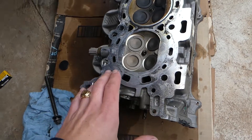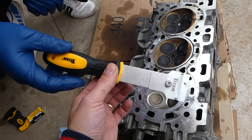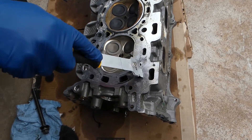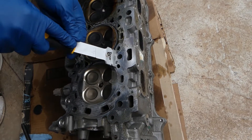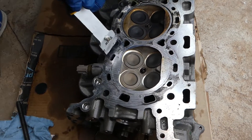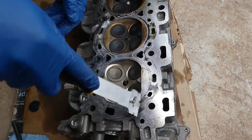You can see the head will be really bad, so what you need to do is get a razor blade. All the tools and parts that we use will be listed in the description of the video below for your convenience. Check them out. With a razor blade, always scrape that way — never try to cut into it, because if you do, you can scratch your cylinder head or engine block severely.